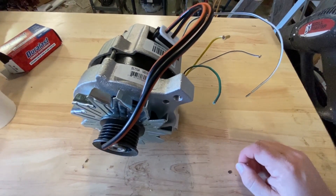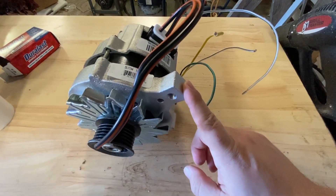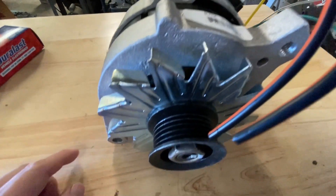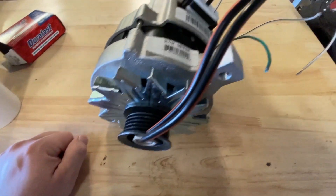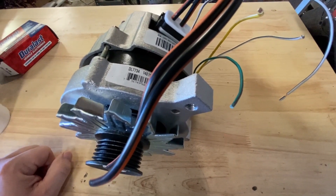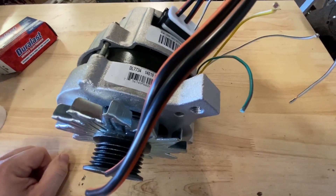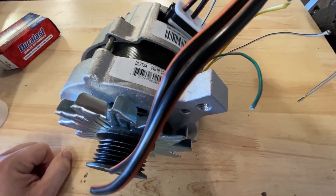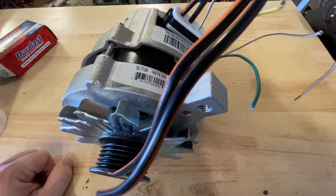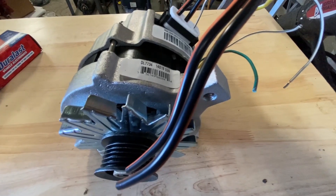So that's how you wire it up. I've got this oriented correctly too — you'll notice this little tab is going to be up near the top. When you're looking at the motor, the bolt will go in through the back and thread in through the back, and then the other one is here and the bolt will go straight through to the back. You'll also need either a socket wrench or a dedicated tensioner tool. You'll put your socket or tensioner tool on the tensioner, pull it towards the passenger side, and that'll loosen it enough so you can get the belt looped on. In a future video I'll show how that's set up.